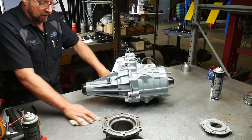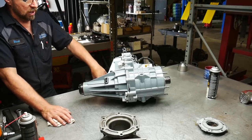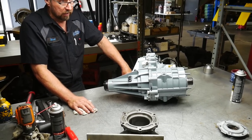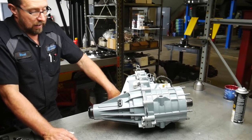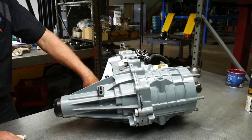We've seen plenty just in the last probably 5-6 years of trucks coming through the shop that didn't have that on. They lost a U-joint and they go from a $35 U-joint and a little bit of labor to the back half of a busted Allison that's coming out of a truck. And that's going to be one expensive bit. That is $1,200 to do a back housing and labor and everything else and pull the case out and get it all back together.